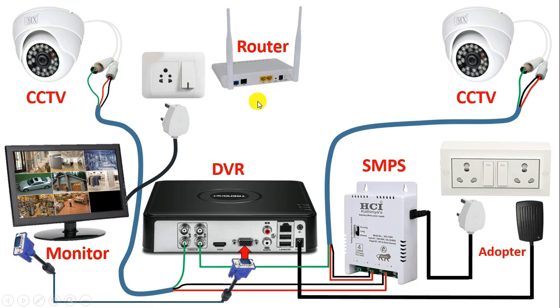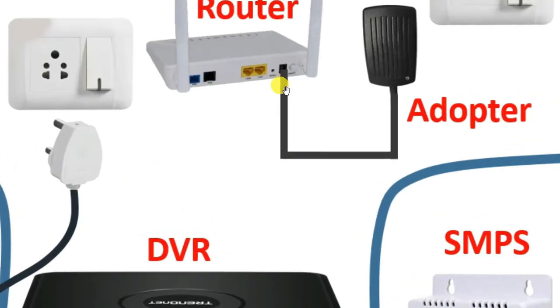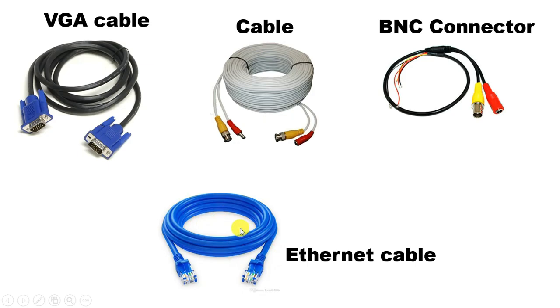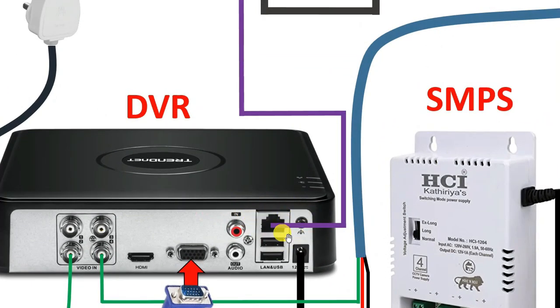How to connect this — let's understand. To operate this router, we have to provide power supply to it also. With this router, there comes an adapter. We have to connect this adapter with the power socket. Now take the output cable of this adapter and with the pin of the router where 'power' is written, connect this cable. So this router will now get power supply. Now through this router, to provide internet connection to this DVR, we have to use a cable. This cable is known as Ethernet cable — we use this Ethernet cable to provide internet connection. At the backside of this router, there is a LAN port. With this port, connect the Ethernet cable and bring this cable directly to the LAN type port given at the back of DVR — with this port, connect this cable.